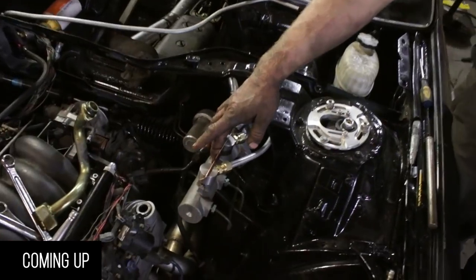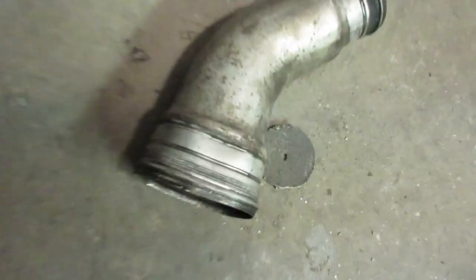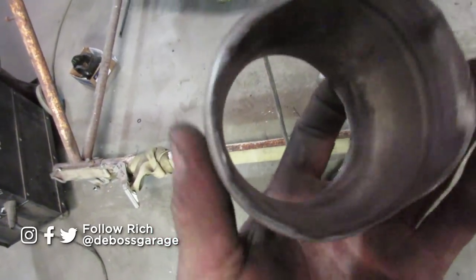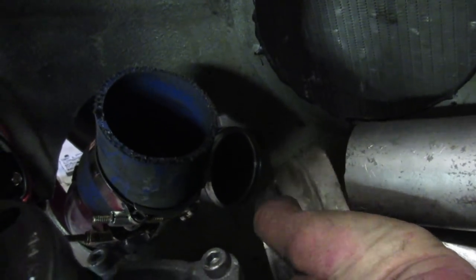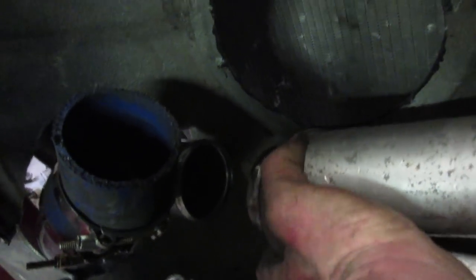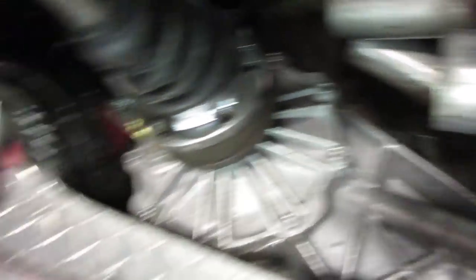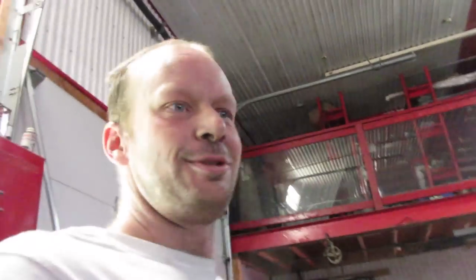We took a master off of a three-quarter ton Silverado, I think. These are my two intake pipes coming from the turbo. I just took one of these big ends, flattened it in the press so I could stick two pieces of pipe in there, then heated up the outside and flared them a little bit so they connect together. We'll tack that up and weld the new ears on the turbo, get the other intake piping figured out to go around the diff, then bolt up the axles properly — and the back half is done. Skid plate time.